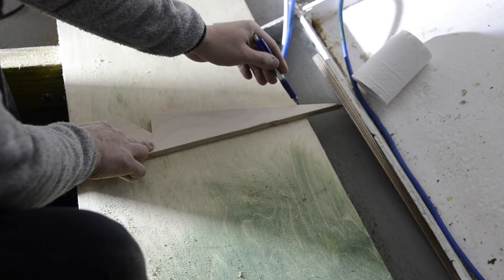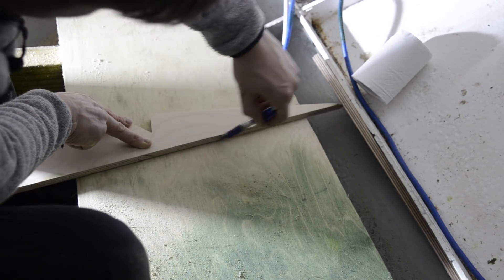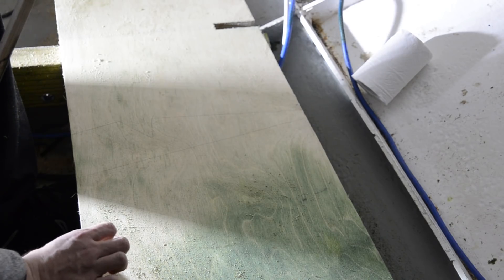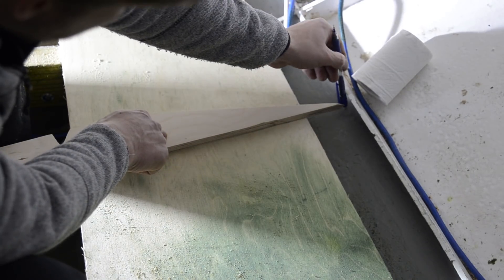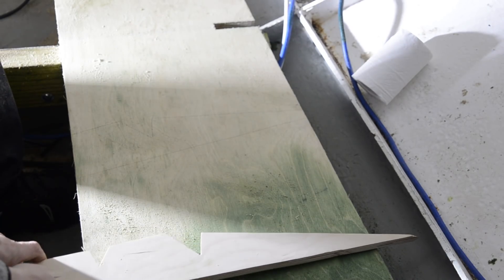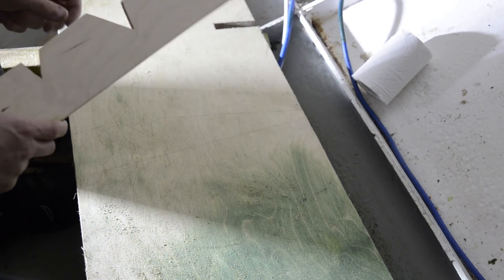So I'm going to mark the shape like this. I know that when it comes to actually marking this out in the final piece, I'll line this edge up with the final edge on the piece of ply that will be the finishing ply. Then I'll put this down on here with this on top of the ply, and then I'll be able to mark my point on the ply. So if I do that all the way along, putting a point every 6, 8 or even 12 inches apart, I'll know exactly the profile of that part. And that's the basic principle of a spiling stick.